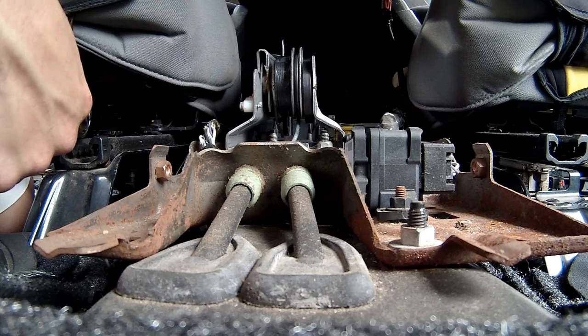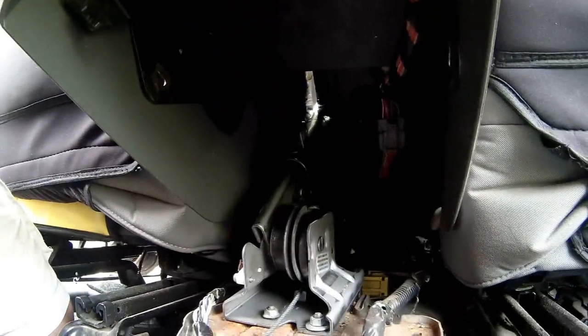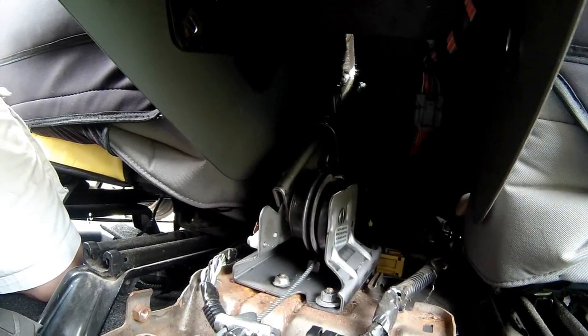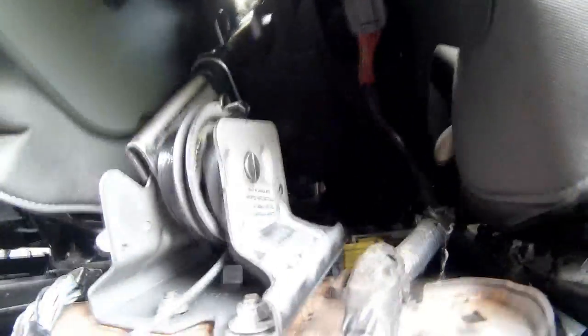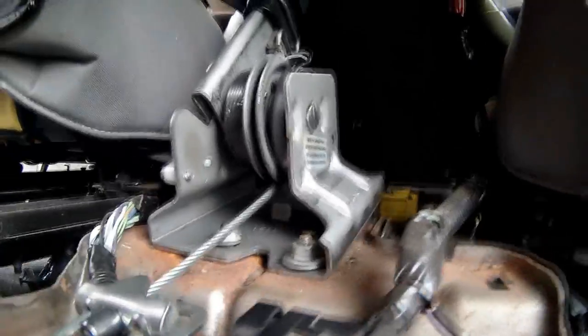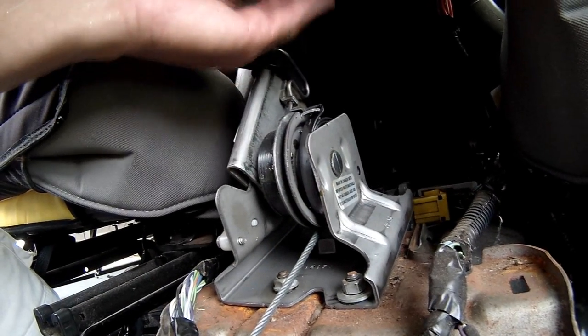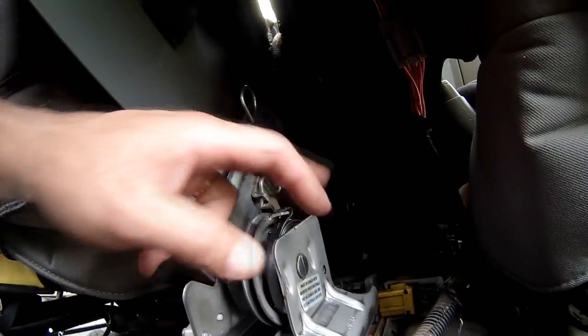Oh dear, I see the issue. How am I going to get my parking lever up because the console is in the way? Looks like I do have to remove the entire thing. I might have made a terrible mistake. What I did was I wound up taking all of the bolts out of the assembly, lifted it up, put it through the hole, and pushed down to try to get the assembly through — but when I did, it lifted up in a ratcheting motion and now it's in at an angled position even with the pin in place. I don't know if I've made a terrible mistake or not, but let's find out.